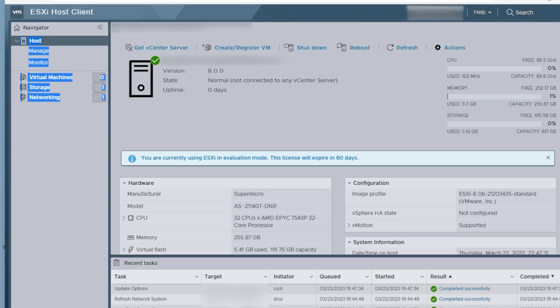AMD has got to build momentum and inertia for these kinds of things, because this level of functionality and infrastructure will eventually be able to move mountains. By building this out, system administrators can allocate virtual machines and assign parts of the GPU — or the entire GPU — to one research group or team. That team is reasonably sandboxed in their virtual machines so they're not disturbing other people using the same resources. You don't need the overhead of dedicated GPU hardware for everyone, because GPUs are expensive, and you can share the load among many different jobs without really interfering with one another.